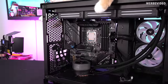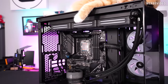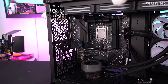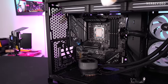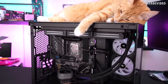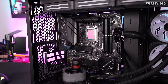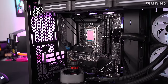I'm going to reuse the setup I used recently to test the Corsair 2500X case — I still had the H150i in place. I just swapped the motherboard because I wasn't sure the cheap AIO also comes with AMD mounting; on the box it only listed Intel mounting. So I'm using this Intel board with the 12900KS. It's not the latest CPU but should deliver plenty of heat. I'm using the same paste for all AIOs — since some come with paste pre-applied like the Corsair H150i, I want the same conditions for all, so I'm using Cryonaut Extreme for all of the AIOs.